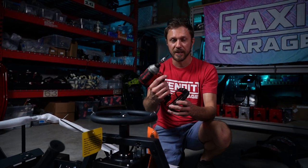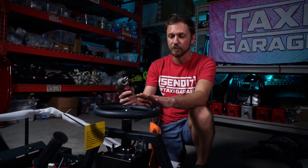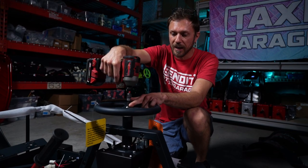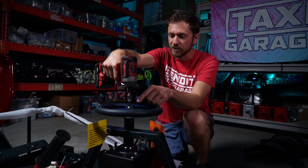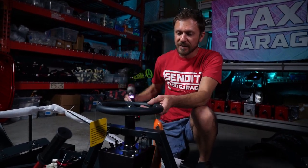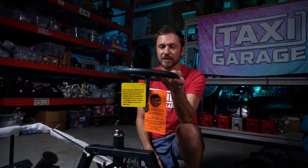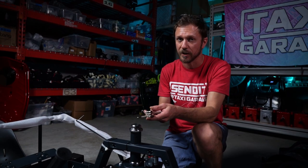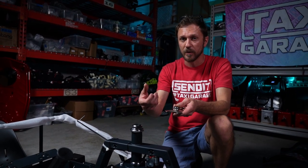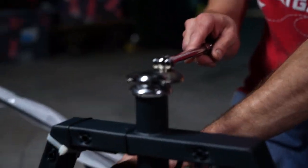Step two: using a 3/8 gun with a 3/8 drive and a 6mm Allen, remove the factory steering wheel. You don't have to fully unscrew the bolt — it has a wedge just underneath it, so you just loosen it a little bit and tap it down and the neck releases the steering wheel immediately. Then use a bicycle headset tool — or open end pliers at home — to loosen the nuts on top of your factory fork.